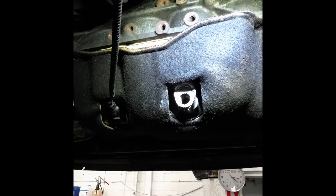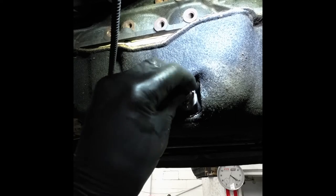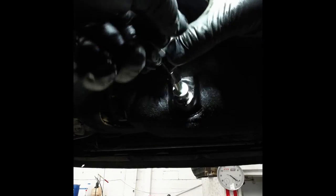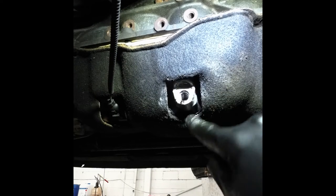What I'm going to do is put a litre of oil in there and let that run out so we can remove all the metal pieces, because that would be rather detrimental to the engine — even though the filter would probably catch it, let's not go with 'probably.' We flushed it with some oil. The end of the helicoil has a little tang which slots into the installation tool and allows us to turn it in, so it's just a matter of lining it up and screwing that coil in.